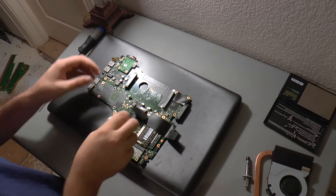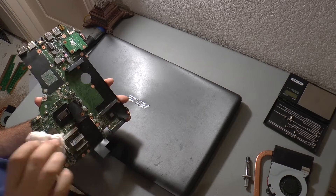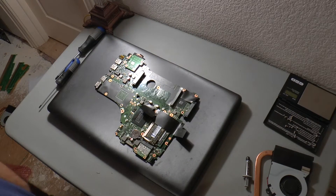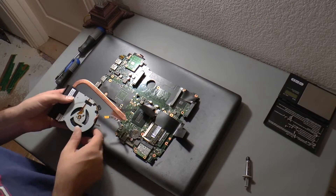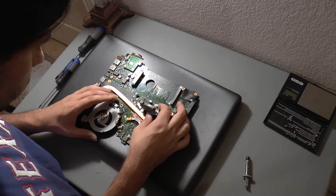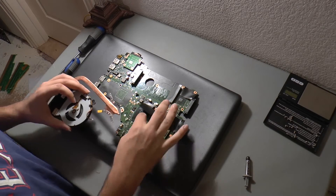So I just have some toilet paper I'm going to use to wipe this processor off. But we're going to put some new compound on here. Before we get too far, we want to make sure that this fan lines up perfectly, so we're just going to dry-fit this first. Looks like it's almost there, but slightly off — so just a little tweaking.